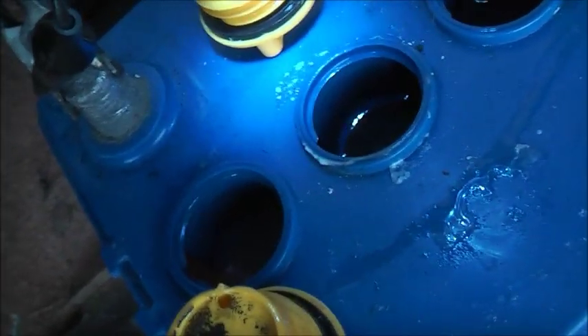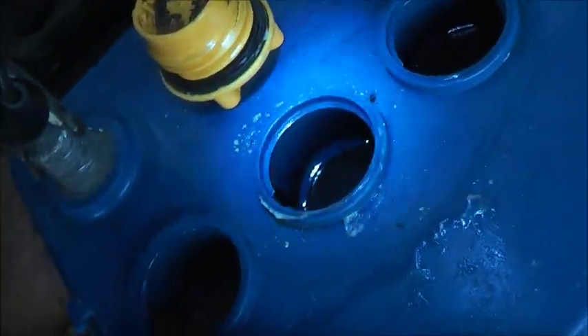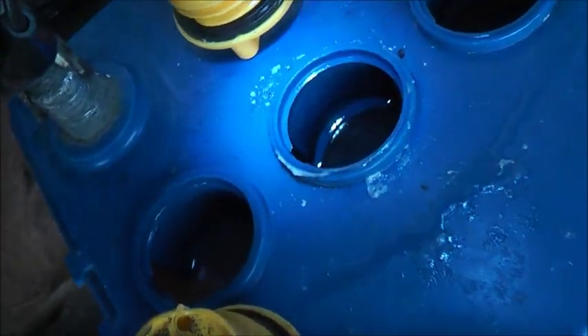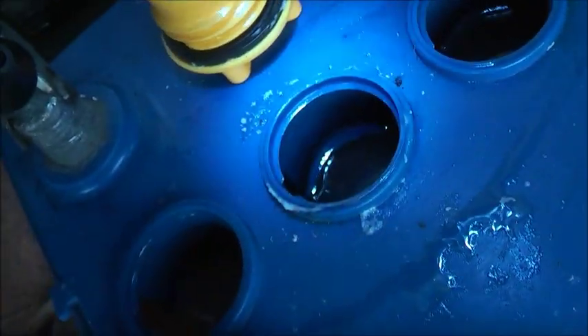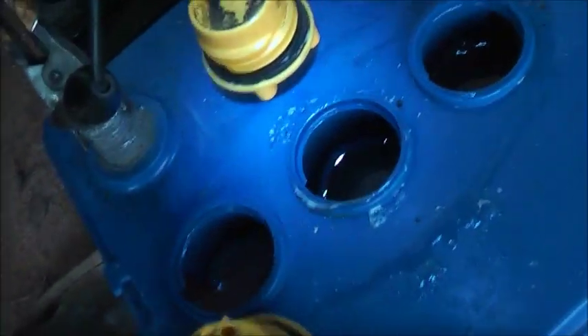So what I've done is take the negative terminal and probe that negative connecting strap, making firm contact with that spoon, and force charged it. I was putting 16 volts through 10 volts worth of cells, and this cell was overvolted to the point that it actually broke through the insulating layer, and now it's actually activated again. Beautiful — I fixed it. That treatment fixed it.